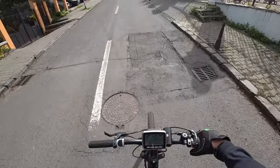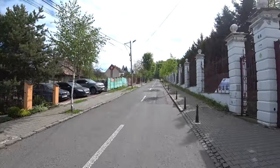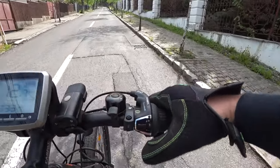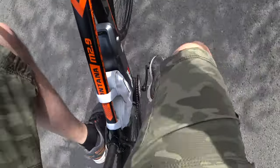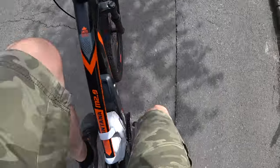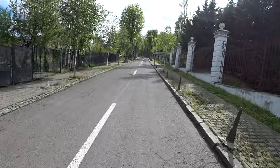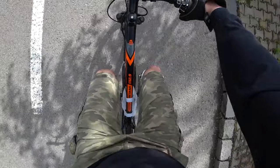Here we go, going up the hill with my new sprocket — it is doing very very well. About 20% less speed but 20% more torque. The gears work really well, they shift really well. In my case it was a $10 upgrade that was really worth it. Thanks for watching and let me know what you think at the bottom.